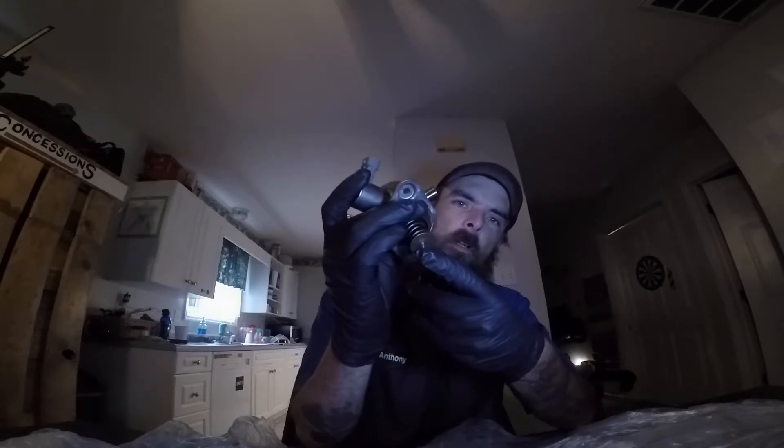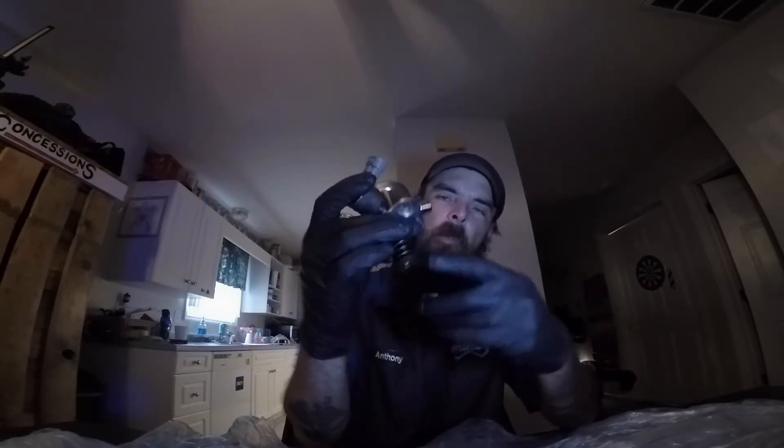It had misfires on every cylinder. He pulled the pump out, and the inside was just caked up and gummed up. This part was literally worn through, and it was worn on the plunger as well, so it wasn't pressurizing the fuel — it was basically just metal everywhere. That person needed camshafts, a fuel pump, and the bucket. It was so bad after further diagnosis that it needed an engine. They hadn't been keeping up with oil changes — and we're pretty adamant: for an EcoBoost engine, 3,000 to 5,000 miles, don't push it over 5.